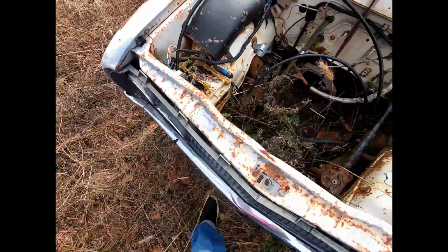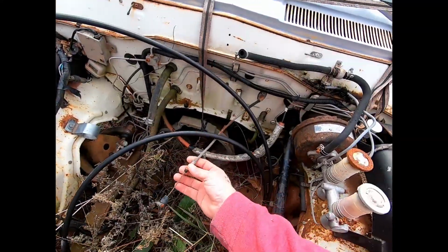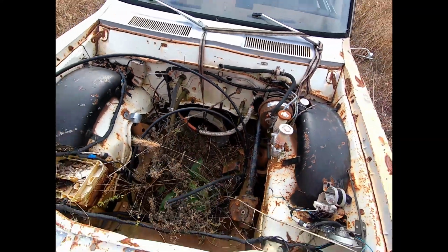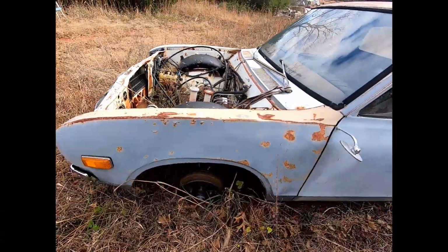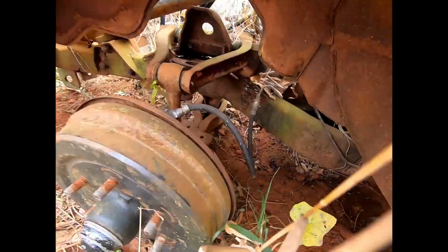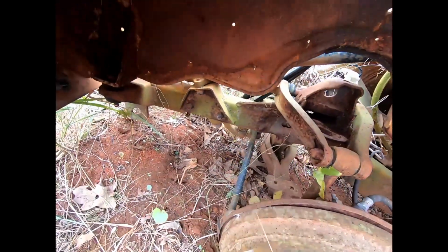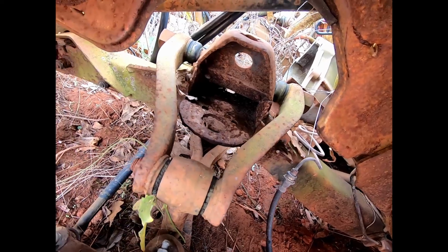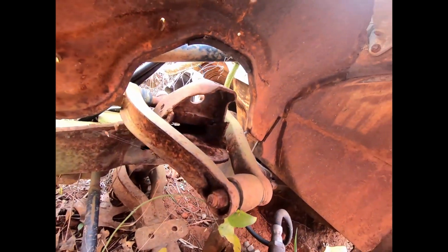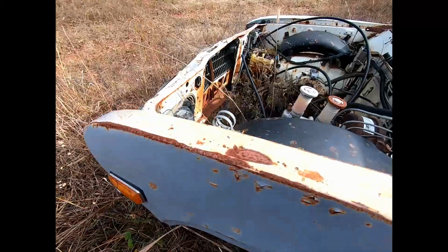Had a little Optima battery in it, and at one time the throttle ended up working as the ground because I didn't understand good grounds then, and it made quite the smoke show. Underneath here we kept drum brakes. You can see those very crude little lower plates that the bag bolted to, and you can see the very crude and ugly upper mount that I built, again all from scrap metal out there. Not the prettiest thing, but I drove the crap out of it.